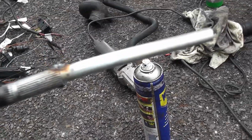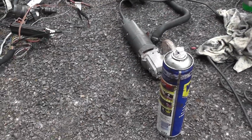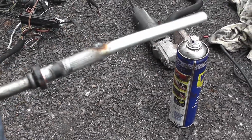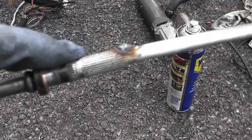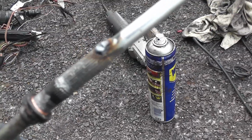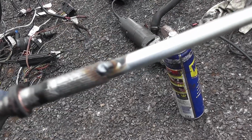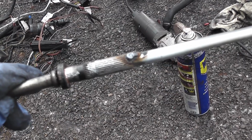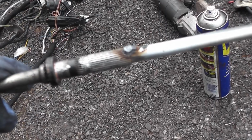So what I was able to do is get an 8mm drill, and first of all I cut the rest of this dipstick off. I drilled this out to 8mm, and I was able to pass the old dipstick through the new dipstick piece here, and I just put a snot of weld on either side of it, and I'm going to just dress that up, and we'll be able to fit that. So handy enough. Next thing is I'm going to bring it over to the bench grinder and just take off that rough weld. Okay, so the dipstick is in now.